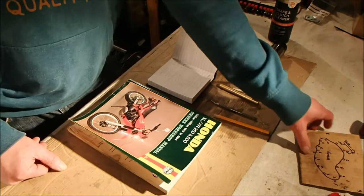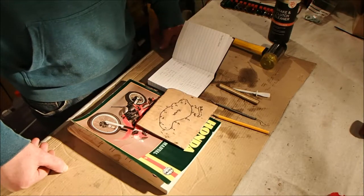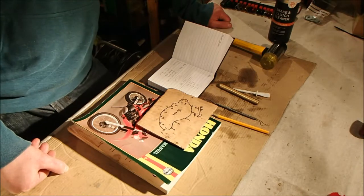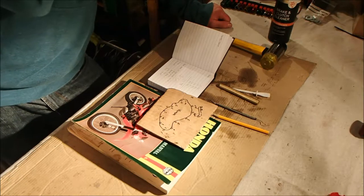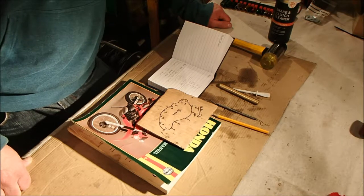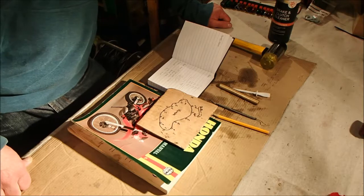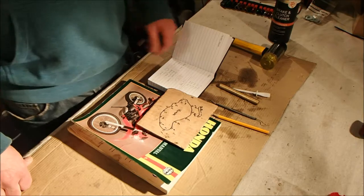The other thing is keeping track of it. The fact that I filmed it wasn't to put it on YouTube, it was so that I could refer to the footage from time to time to see what I did, the sequence of components coming apart, any little thoughts I had while I was pulling it apart, any important bits that I should refer to when reassembling. I used that footage on several occasions, and on one occasion I couldn't remember whether I'd fitted the valve stem oil seals, well after I'd fitted the head, and I went back and double checked to make sure that I wasn't going crazy, and they were fitted.